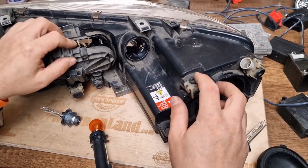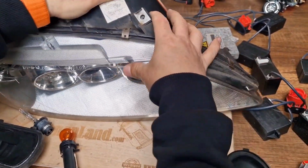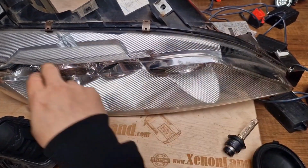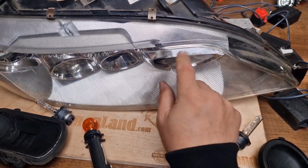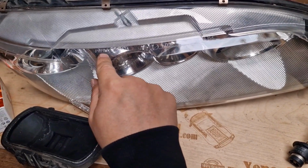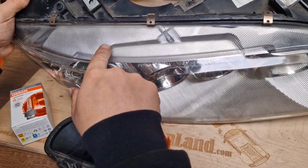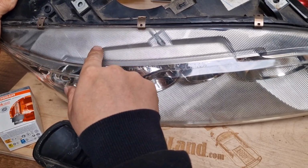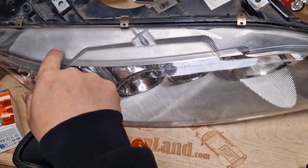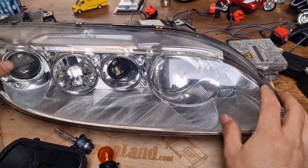If you wonder, by the way, it's just enough to look at the top of your headlight to see the bulb types. If you have all the options, you will have one H1, one H3, one PY21W bulb and a D2S type xenon bulb. If you have a xenon type headlight, the D2S type xenon bulb is your low beam, or if you have a halogen type headlight, your low beam is an H1 bulb. I guess that's all for the Mazda 6 GG/GY models.